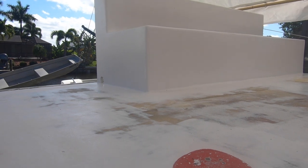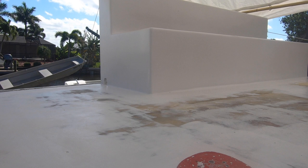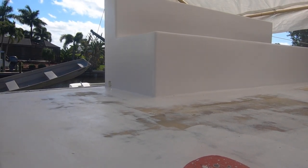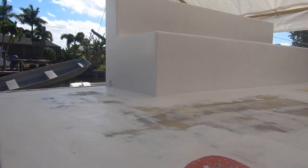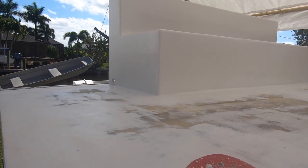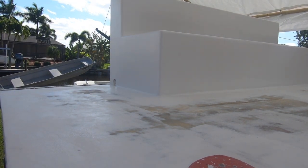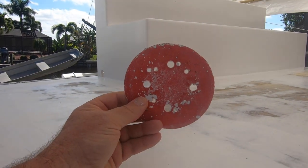And I realized I forgot to put wax in it. Yeah, so that's totally on me. If you don't put wax in the gel coat, if you're using unwaxed gel coat, which is what we use, it's a laminating gel coat, so we can put multiple layers on. If you don't put wax, it's never gonna get hard. You're never gonna be able to sand it without that.